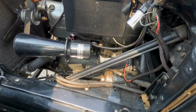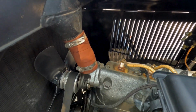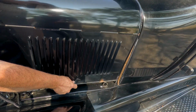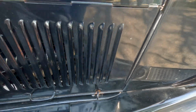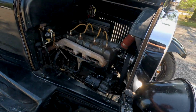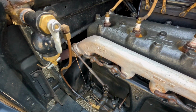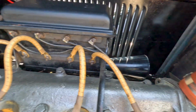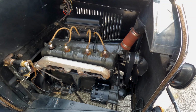And then coming underneath, you'll see a very unmolested engine compartment. That L-head 4. I'll open up the other side too so we can pan. And there you'll see where the generator's been converted into an alternator, still a 6-volt system, and the nice clean magneto box. That has all been gone through and serviced. We'll fire it up and show you some lights working.